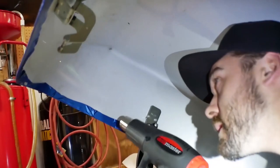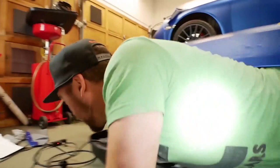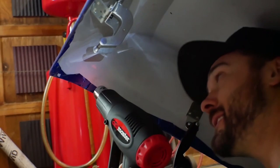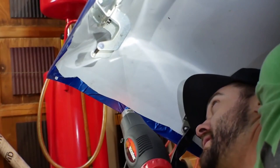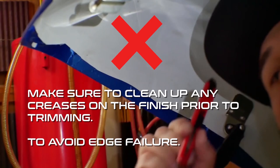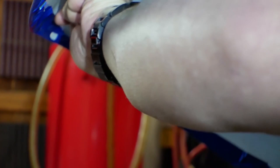What you want to do is heat it up, get it blistering hot — that'll activate the adhesive. Then with your squeegee, really push it up against the surface. It doesn't matter what it looks like at this point. The last thing is to take a sharp knife and do it as clean as you can — about a half inch to an inch — and just slide it along. You can score it, or in this case just cut it and peel it off, and you can tell that looks a lot nicer.